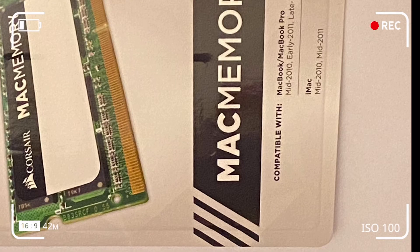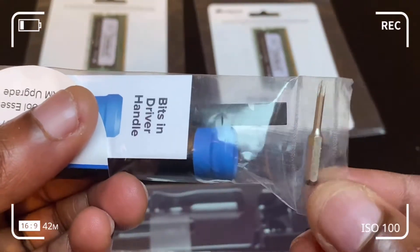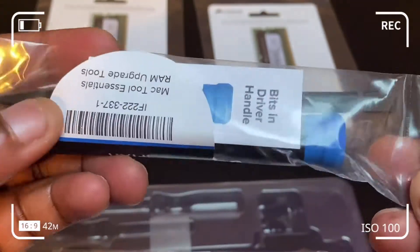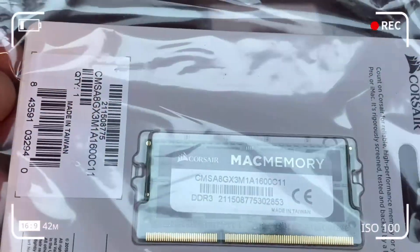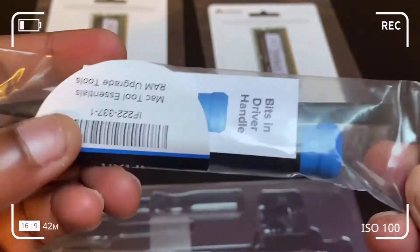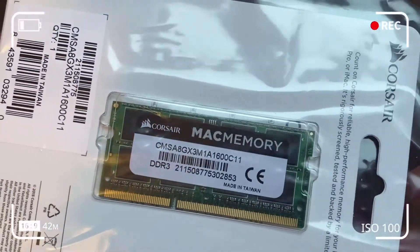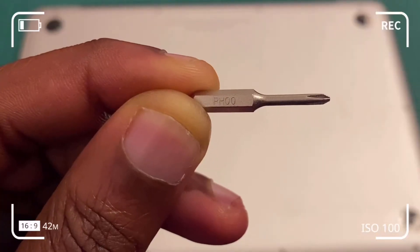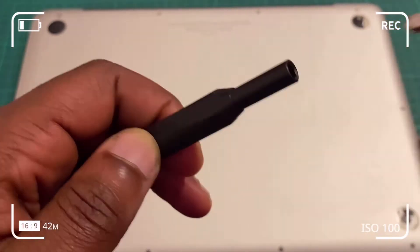To carry out this rework we need a simple toolkit and two RAM sticks. You've got three screw bits: the PH00, the P6, and the Y0 — you only need the PH00 and the P6. You've also got a plastic spatula and a magnetic bit holder. We'll start with the PH00 screw bit fitted into the magnetic bit holder.